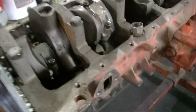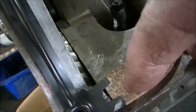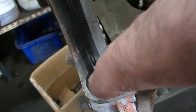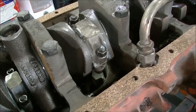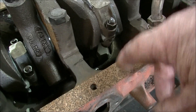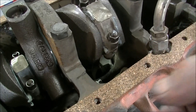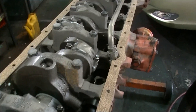We'll put the other seal in there, put the main gasket on, whack the sump on. So with the pick-up on, end rubber in, front rubber in — see how we've got them nice and overlapped in there, like that — nice. I'll just put a little tiny dollop of silastic in there, just a tiny one. I don't normally like to put anything on the cork, especially with this rubber-impregnated cork. You put silicone on that, as soon as you start tightening it up it's just going to split and squirt out. So I'd rather just leave it dry.